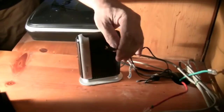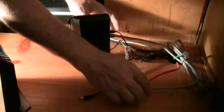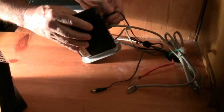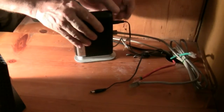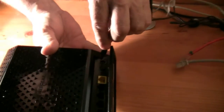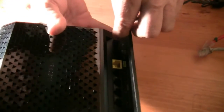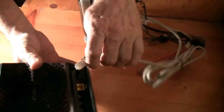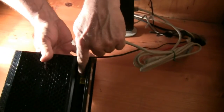Plug the power cable for the new router into your power source. Ours is under the desk, so after plugging it in, Bob slipped the cable up through the hole in the desk. Before plugging in the new router though, reconnect the modem's power cable to the modem. Connect the router's power cable to the port on the far right side on the back of the router, then plug the cable that leads from the modem to the router into the yellow colored port.